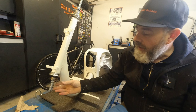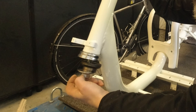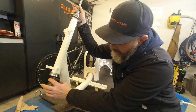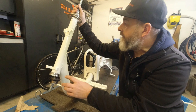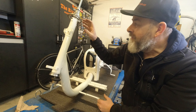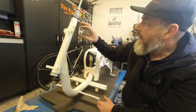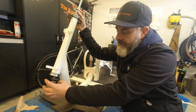I use the silent block on the top - it's actually a perfect fit inside where your top race fits. Then an array of washers and stuff at the bottom. What I did at the bottom is I used an old crown race which I turned upside down and held it at the bottom. You thread down the bar with these gadgets on, and you pull in one race at a time - that gives you a much better chance of not elongating the area where they sit, and a bigger chance of getting them in flush.